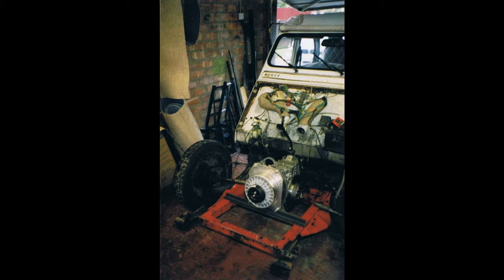But 6000 rpm gets you to 70mph, which is much more satisfactory for a 2CV. It also increases the power - I was running it at 96V rather than 72V, so it was able to put out about 15kW. The one disadvantage about this motor is because it's quite small and not very heavy it doesn't have much thermal inertia, so it's not very good at running at higher currents than its rated current for extended periods of time. You have to make sure you rev it and allow it to cool as well as you can.